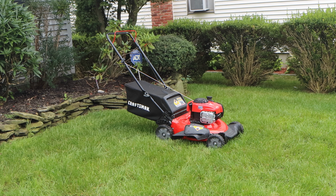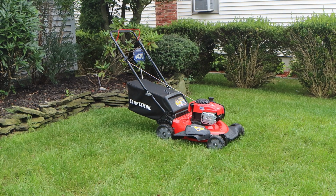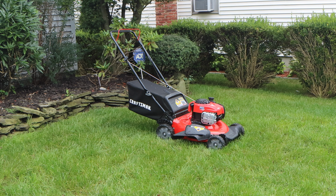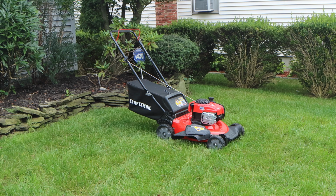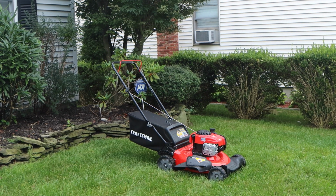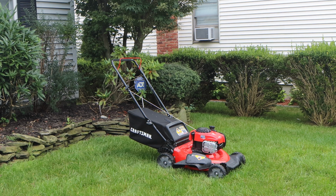Alright guys, so here our lawnmower is in its final resting place. Off camera, I serviced it, reconditioned the blade, pressure washed underneath the lawnmower to clean out the inside deck. If you guys decide to do that on your own, remember to tip the muffler down on the ground. That side goes down on the ground. The carburetor faces up to the sky, and you pressure wash, clean, service, whatever on your way. I elected not to do that on camera because I have a ton of videos on servicing your lawnmower. If you feel so inclined to check that out, by all means do.